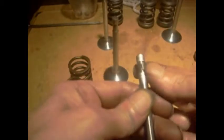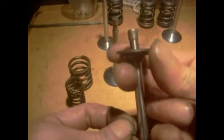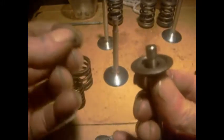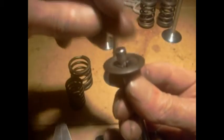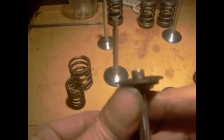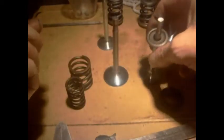And they clip into that groove with the thick end upwards. It's easier to show you than it is to show you when I put them in the head. And then when it's all together — you have to push the top down to about there, and then you drop a collet in one side and a collet in the other side. And then when you let the spring off, it springs up and it can't come off after that. Hopefully. And usually you donk on the top with a hammer to seat them.